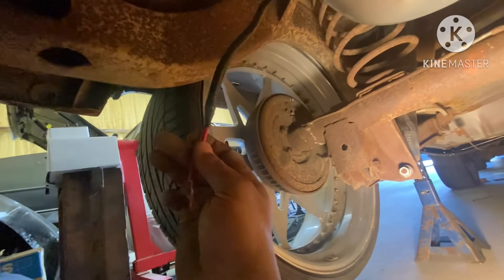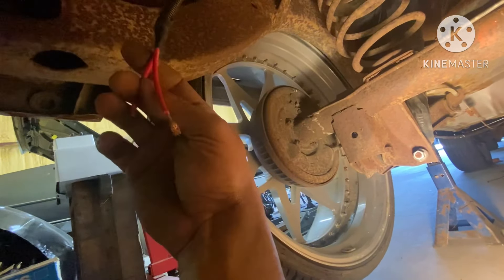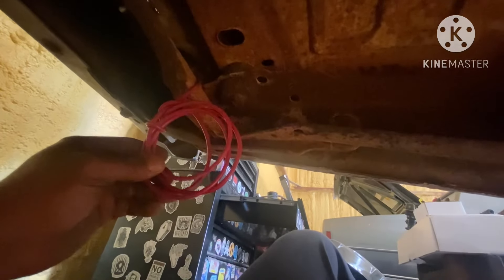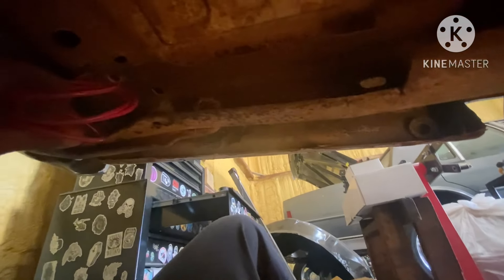I got the wires just hanging right there. This is the wires coming from the fuel pump — my positive and my negative, two wires, they're both red. I'll put black tape on one to let whoever comes behind me and works on it know which one is the negative. If this is my hot wire coming from the harness, I'll run the ground from the frame and make a connection right on top of the tank for the power and ground. And then this wire here — that's my wire for my float, for my sending unit to go inside the car. Like I told y'all in the Dakota Digital video, this wire is a pink wire — that's how I know that the pink wire behind the dash was my sending unit wire. Because usually GM ran a pink wire in the back for the sending unit.